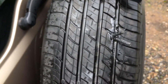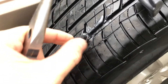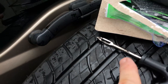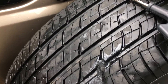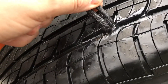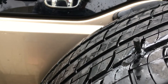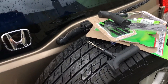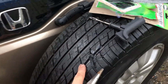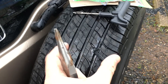It's in a good location - it's not on the sidewall, it's in here pretty good, slightly in on the tread, and I pushed it in pretty far. That rubber is at least two inches inside, and the idea is it's going to expand on the inside and outside. We'll let that dry, then I'll trim that off and put air in it. The most important thing is putting the reamer and the rubber plug in at the same angle as the hole - in my case a slight sideward angle - so you don't cause more damage or a wider hole that might not seal up.